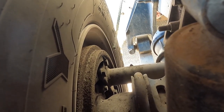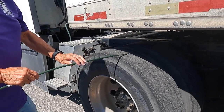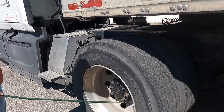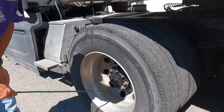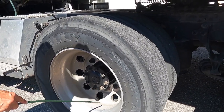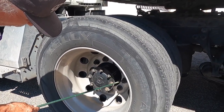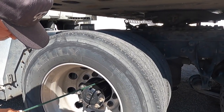dangerously thin. My tires, my drive tires: no cuts, no uneven wear, no bulges, no less than 2/32 inch tread depth, and they're filled to the operating range and checked with an air gauge. My rim has no welds on the outside or the inside of the rim. And my valve stem and cap are on tight. My lug nuts have no rust trails, shiny threads, or drawn-out holes, which indicate a loose lug.